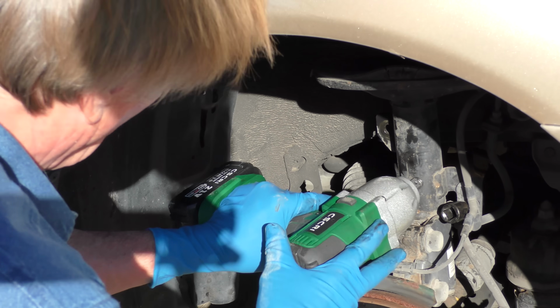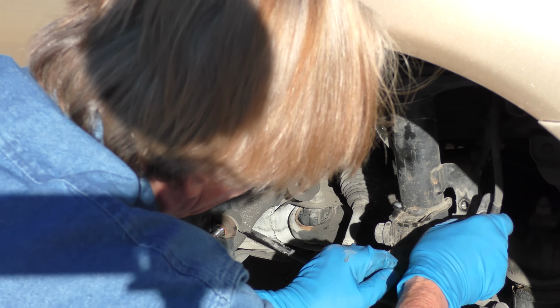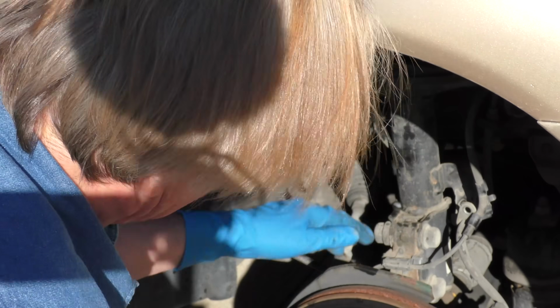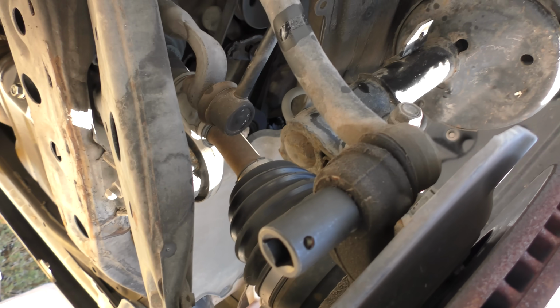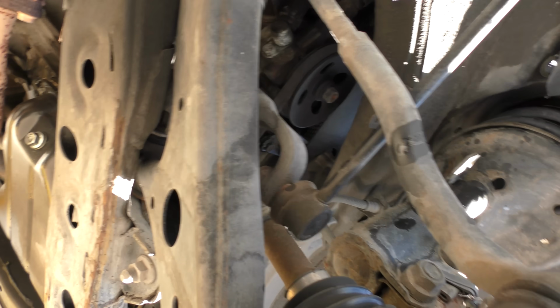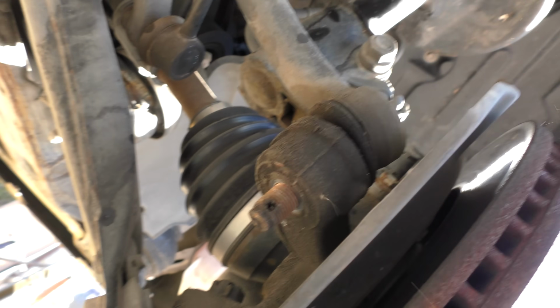So we'll take this bolt off for the lines here, and we can get that out of the way so they don't get in the way when we take it off. You use a pair of cutter pliers. You're getting a new one. You grab it and you pull it out of the hole. See how it's coming out? Okay. Then we get that loose, and that's where the impact wrench comes in real handy. Doing it by hand can be a pain. Things can slip. You notice that takes it right off.